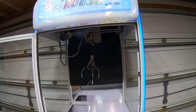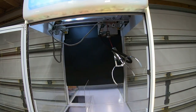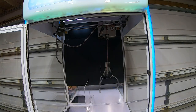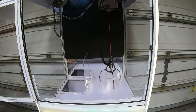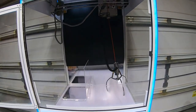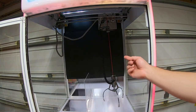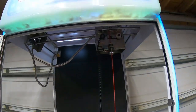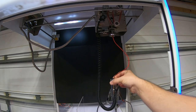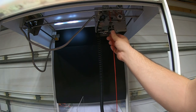Here's what's happening with the machine. The motor moves and you can move it around — it goes back and forth, left and right. All works well, but it's the up and down that's the issue. Watch what happens when I hit the button: it moves down maybe four to six inches, closes, and then doesn't come back up. It just opens back up and throws an up switch error. What it's looking for is the claw to move back up and hit this, which lifts this up and opens this switch right here. Because it didn't open that switch, that's why it threw an up switch error.